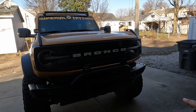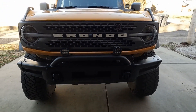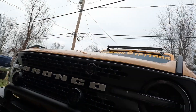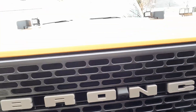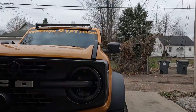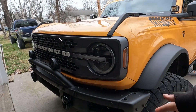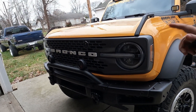Now we're going to relocate the Active Cruise Control — it's going to go from here up to here so we can lift the bumper so it lines up, then do the rear bumper as well. With the lights, we can just take these three screws out. There's a bolt underneath and a zip tie. Same over here — we'll let those dangle. Pull that off. It does have the front sensors, so there is an OEM wiring harness right there — it's hard to see but it's right back there, just a clip. If you don't have the front sensors you don't have that wire, so you don't have to worry about it. Since he does have them, we'll disconnect that and take this bumper off.